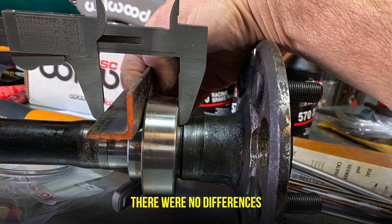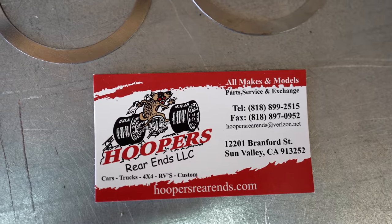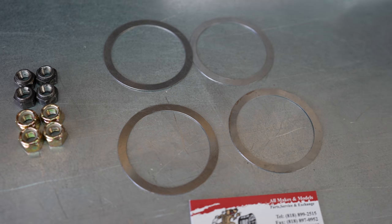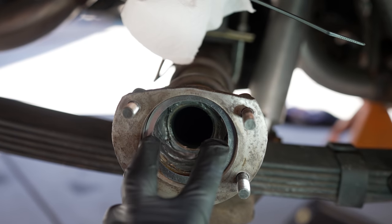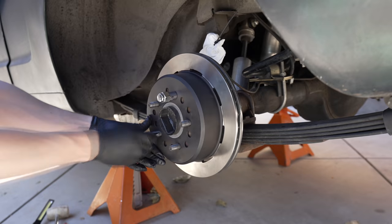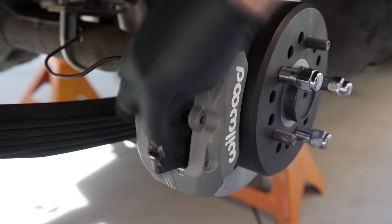I'm just going to blame it on the old axle. I reached out to this company called Hoopers and they offered to give me some shims that fit inside the axle housing to hopefully fix the play. On the way home I also picked up some grade eight nuts and bolts. When I got home I put in the shim inside the axle housing and it worked perfectly — put back in the axle with the bracket, mocked everything up, and there was no play.